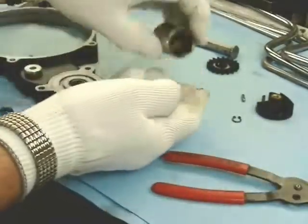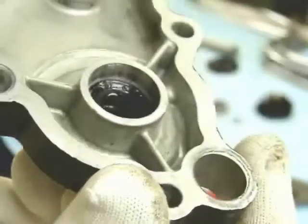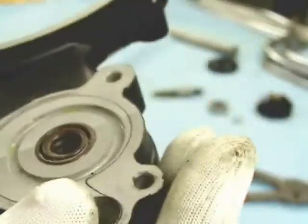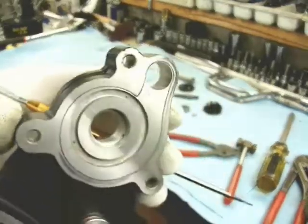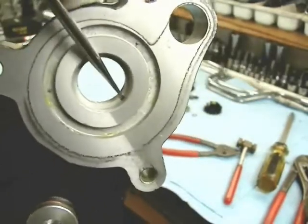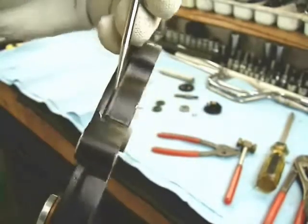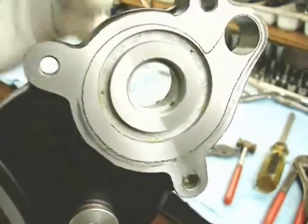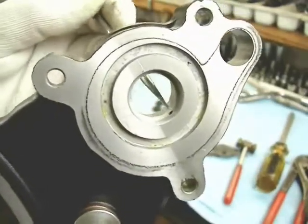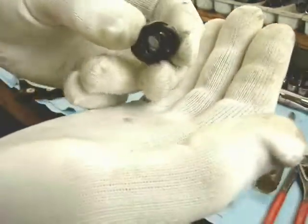It's a very mild interference fit between the bearing and the case piece, and there are different machined ridges — you really can't mess this up. There's a small hole between the two seals, and if one of the seals goes bad, the liquid will bleed out through the small opening on the bottom of the case. So if the water pump seal goes bad you'll be dripping water there, or if it's the oil side it'll be gearbox oil.